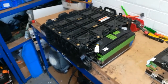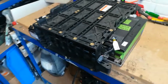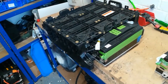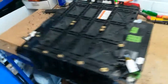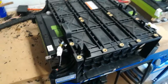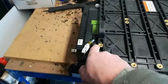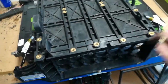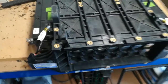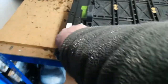I've just hollowed out a standard case - cut out those two supporting struts, or webbings, and you can see now we have two packs inside a standard OEM case. The positive is at this end, so you don't need very short wires to go to the switchboard connection. The switchboard obviously goes on here and you can still get access to the terminals.